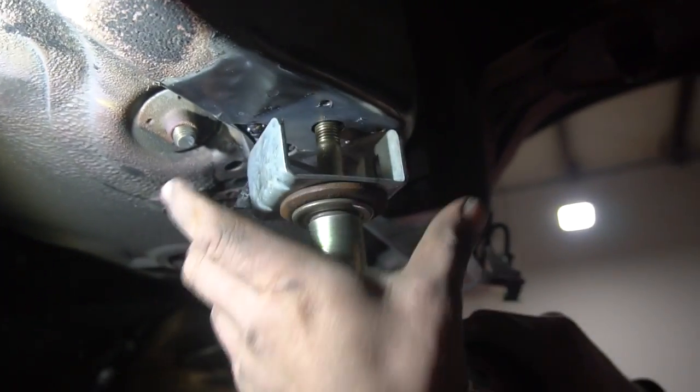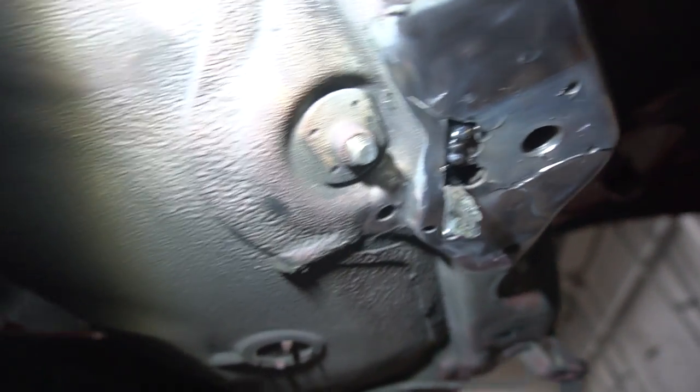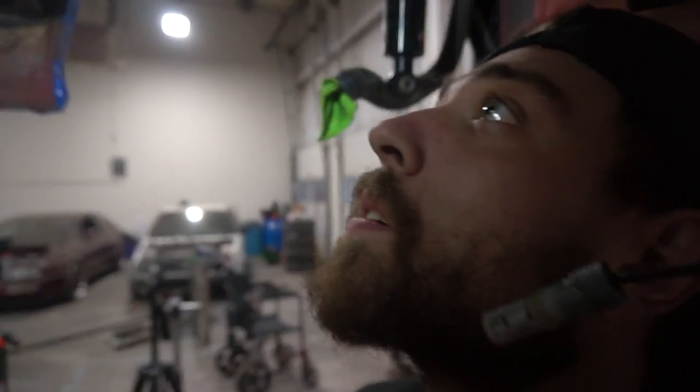Welding upside down — it gets gunked up so quickly. That was actually working out, it should stay in place now. Look at that — perfectly flat. That was dimpled in quite a bit; you can see where the subframe was just bashing it. So I'm going to grind this away, put it flat, weld all these cracks up, and then we can weld the plate on.